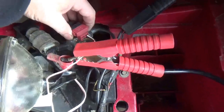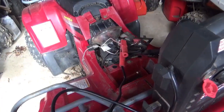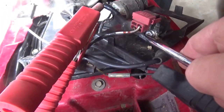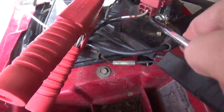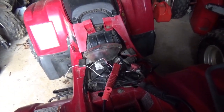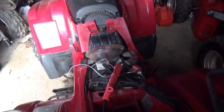The next thing is I also see the wires are slipped around here. We'll do a little bypass action on the starter and see if we can get it to turn over that way. Let's try to bypass the starter solenoid and see if the thing will go around. Seems as if the starter has a problem — either the starter wire is hooked to something other than the starter, or the starter is dead. I don't hear the starter clicking or trying to turn over.